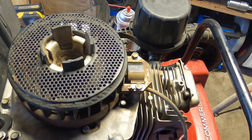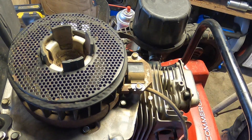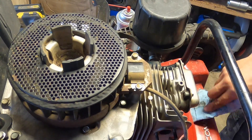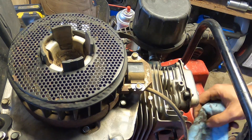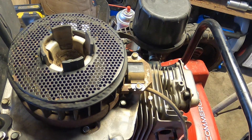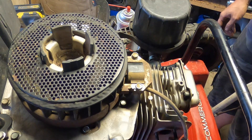Don't just eye it over because it's just not a good idea. Improper coil gapping can be destructive — it can damage your coil, could damage your magnets. The reason I also want to show you the screwdriver is that a lot of flywheels will have a counterweight — not this one because it's cast iron, but some of them, especially the aluminum ones, because the magnet is probably heavier than the aluminum around it. That counterweight can look very similar to the actual magnet, but it's not. So use something metallic like a screwdriver and make sure you're gapping it on the magnet and not the counterweight.